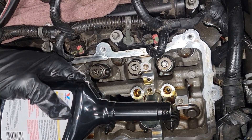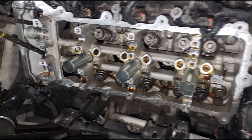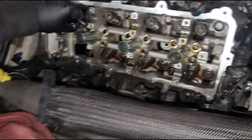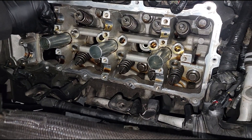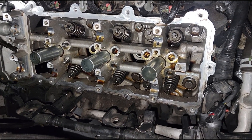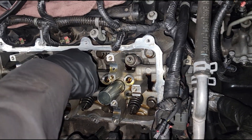Don't get in that spark plug hole. We're oiling them so they won't develop dry startup when you first start the car. The oil pump is gonna try to run and deliver oil pressure to the valvetrain - that has to be quick - so if you're building the engine already, it's best to already be lubricated. These are hydraulic lifters, some call them lash adjusters - they got several different names but they all mean the same thing. Totally different from a pushrod engine cam-in-block design; this is a dual overhead cam engine.